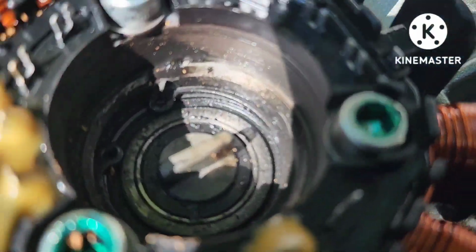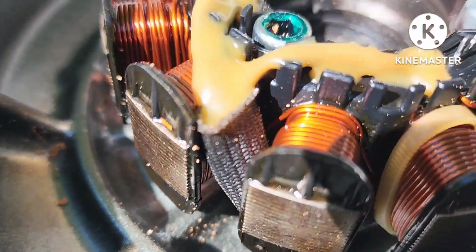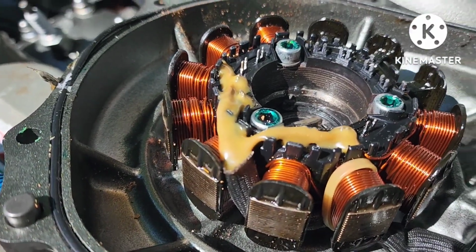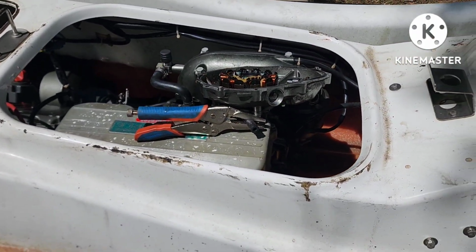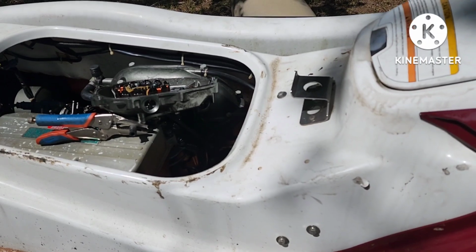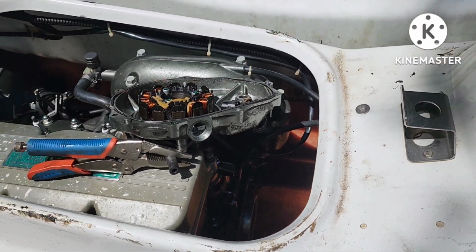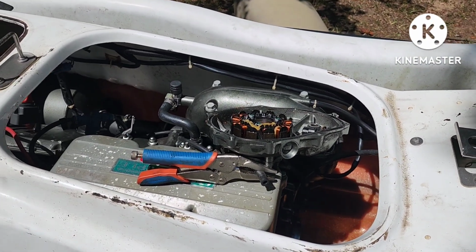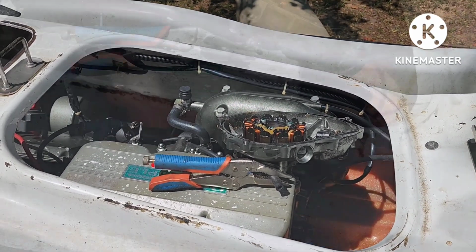This thing's focusing all right. The bearings there. Really, if you're going to eliminate the oil pump, you should take this on out. These bearings feel great on this one, though. I'm going to guess this is a very low hour ski. That's going to be my guess. But I'll get some brake cleaner. I'll clean all this up. I'll sandpaper. Everything looks clean, which leads me to believe that the CDI box itself is bad on this unit. That's usually what it is.